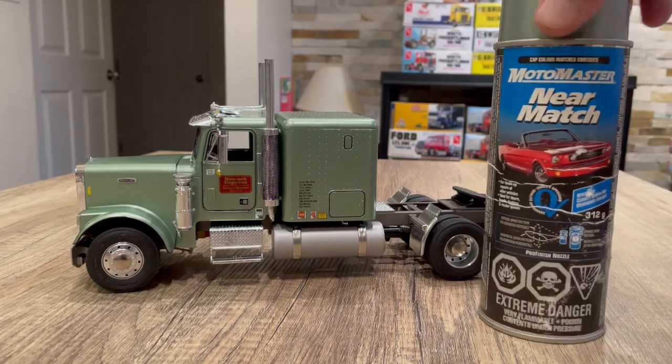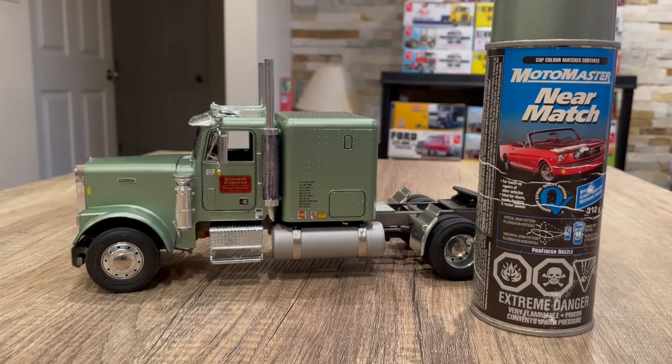The thing about this can of paint is very interesting. I was always an adamant Krylon user — in my opinion Krylon is one of the best paints that was ever out there. Up here in Canada we can't get it anymore. But this particular can of paint is actually from about the year 1998, and I literally just used it on this truck maybe two weeks ago. It's a lacquer paint; I had to use a lacquer primer that was compatible with it.